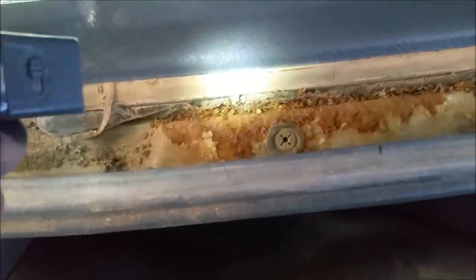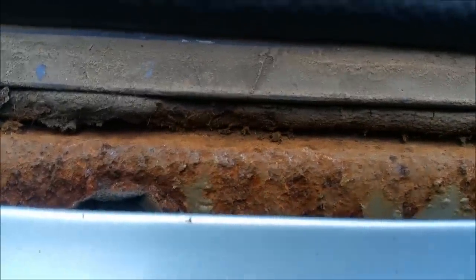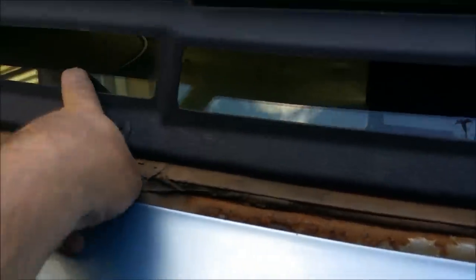I took this lower rear screen trim off and everything looks good until you get to the centre - we do have some rust there. I don't know how bad it is. It all looks good right up into the corner - but you can't really tell unless you take the glass out, which I didn't really want to. I'm going to paint this, but I really wanted to take the screen surrounds off, paint it, then put them back on. That's not that bad either. Eventually, probably in a few years, you might want to weld a piece in, but still solid - you can see it's scaly. To fix it properly we do have to pop the window out. At the end of the year this Plymouth's going for trimming - maybe it isn't a bad idea to take the window out and weld up those bits. Taking the side molding off and we're pretty much exactly the same as the front - with really good news. That's really good, that's excellent.